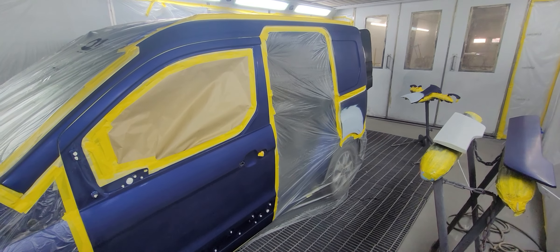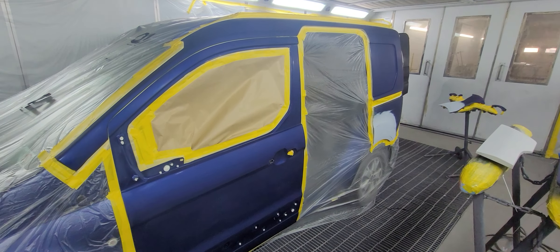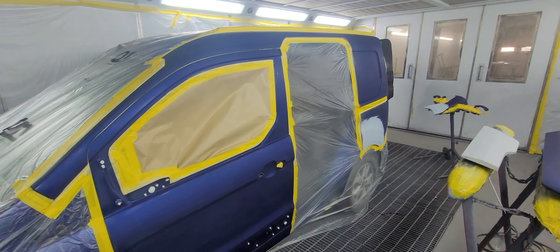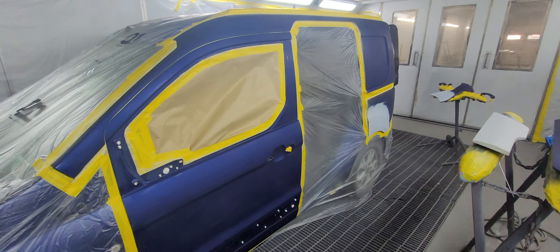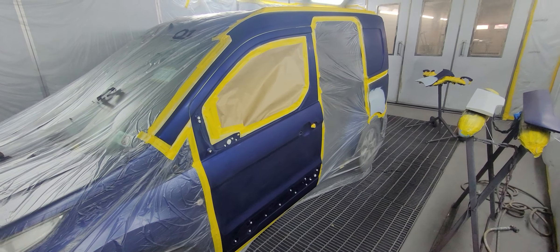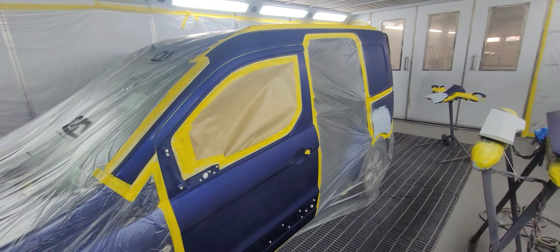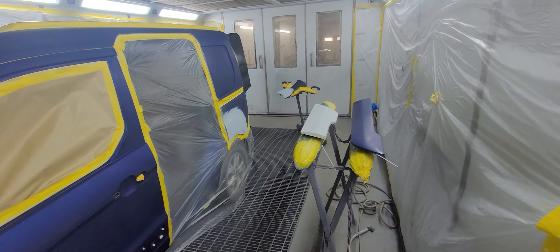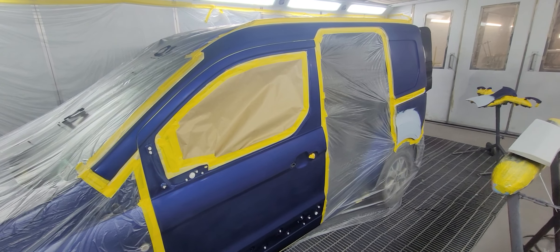But yeah, all water-based, and then water-based degrease, then I like to go over with thinners — just something I like to do — and then I go over with solvent. We had a paint rep in the other day who said finish with water-based degreaser. Fuck that — it leaves water marks on it, and when you paint silver or something you can see them. They're dickheads, mate. Water-based last? Fuck that. Solvent last — gets rid of all the water marks. See how we get on.